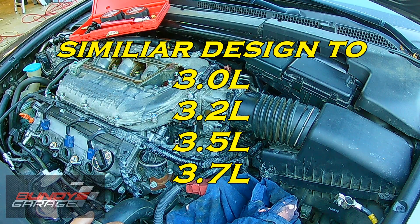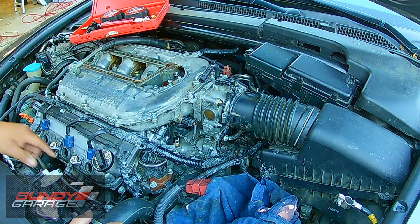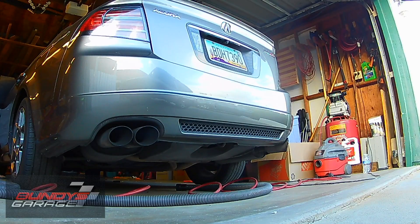What I'm experiencing here is I thought the timing belt was off and it's not, and I'm getting misfire codes in cylinders 1, 2, and 3. The front are okay, but I wanted to find out what was causing the cylinder misfire. I've been chasing this for a while and when you fire up the vehicle, white smoke comes out of the tailpipe along with the misfire codes.